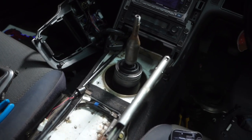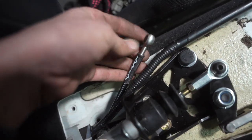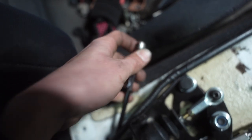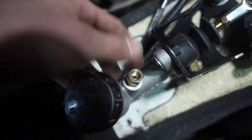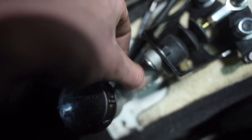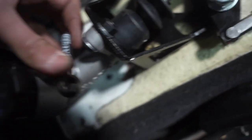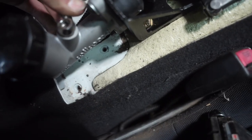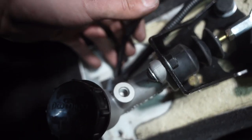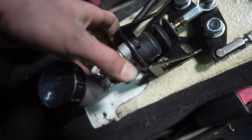So I just fished the bottom hydro line. This is a banjo fitting, and then this is a gold fitting that Wilwood supplies. According to GK Tech, you don't need this — it's just restricting it. So you put the banjo bolt up here, and then it just goes straight down and back. I do have to do a little bit of adjusting to get it to fit, but other than that it should be pretty simple. This whole thing is super easy to do since your e-brake already runs into the car — I didn't have to drill a hole or anything, everything is just there ready to go.